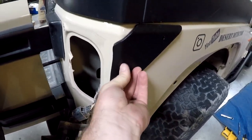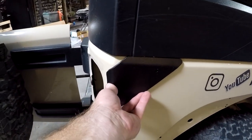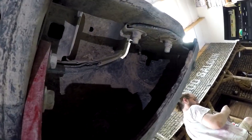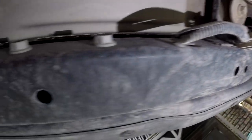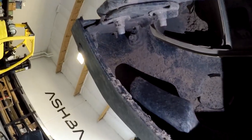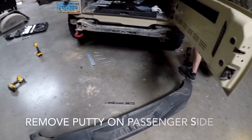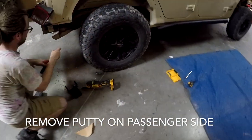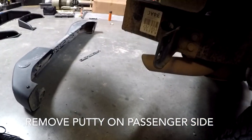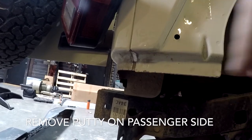This piece on this side goes right up against the back tail light. We have to pull the tail lights out to get to the bracket that goes down inside there. To get the back bumper off, there are those two bolts right there, four in the middle, and two on the side as well, and then the bumper should come off.